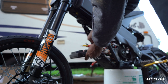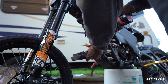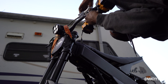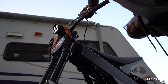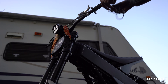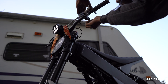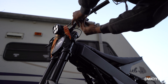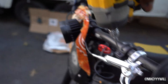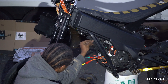That gives you full access to take off the full speed controller. There are also two little triangle bracket pieces — don't forget those, you have to take those out too. This is the Egg Rider SV-102 and it just plugs right in — plug and play. Don't get the wires mixed up between your previous one and your new one; it's easy to think it'll fit when it doesn't.